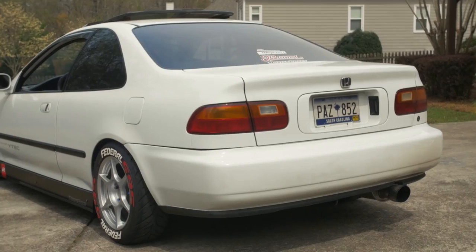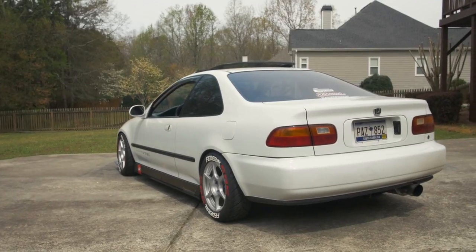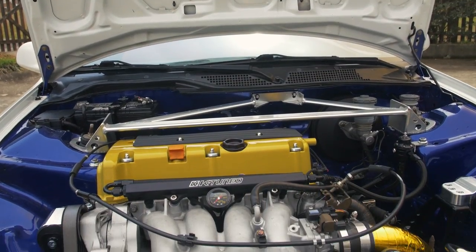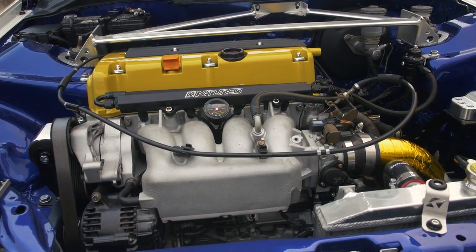This is just a good-looking car — super simple, not overzealous. VTEC hits at around 6,200 and the rev limiter is at 8,500. This thing has an S2000-esque feel because it's a K20, not a K24 — it's a little civil at the lower RPMs, but when it hits VTEC it just takes off and turns into a totally different car.